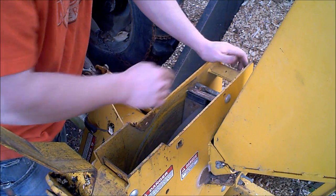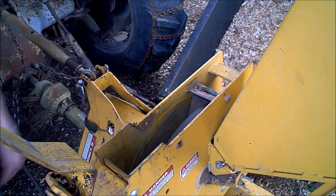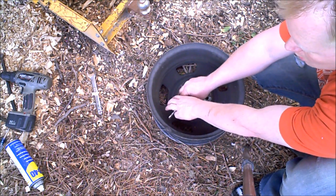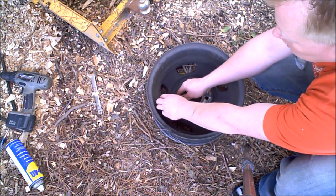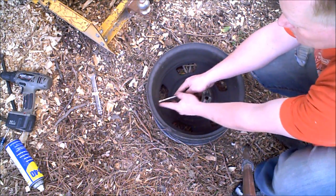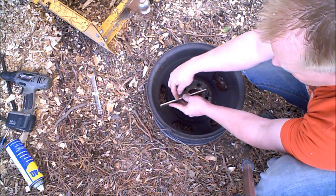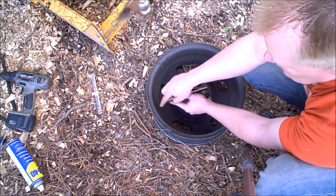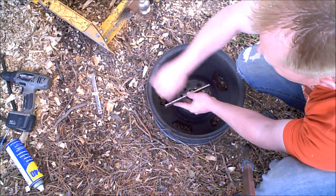Your rotor is spinning in the middle but they have to leave a gap. Whether it's snow or wood chips, as this is spinning to throw out the wood chips, they're actually falling over the top, losing their momentum. Also the speed right here is moving slower than further out — the further out it goes the faster it is, the faster the velocity. The faster, the more throwing power you have at the opening.